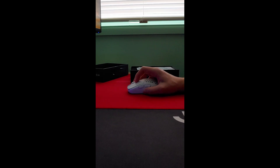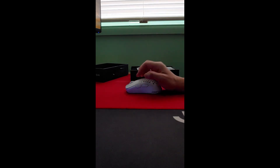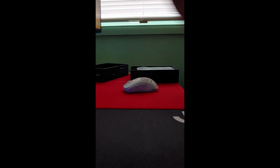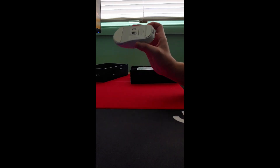A lot of people don't know this, but having more distance between the surface and the sensor on some wireless sensors can lower the CPI. So you can actually test your CPI before doing this fix — if it's fine, you don't need to do it. But if it's not, you can use this to fix your CPI deviation and LOD issues.